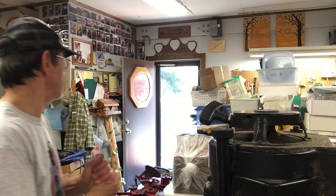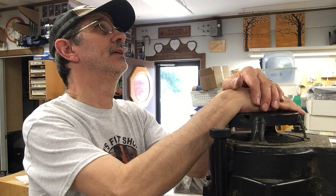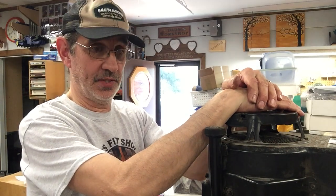The old machines — my uncle had an old one, I'm not sure what the name was — but that had an alternator slash starter. One item did both. You put power to one side of it and it spun the engine over. Once the engine started, the other side generated 12 volts to charge your battery and run your headlights. It did both. So he's half right.